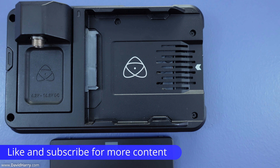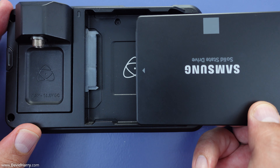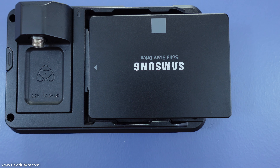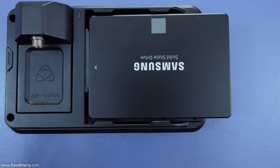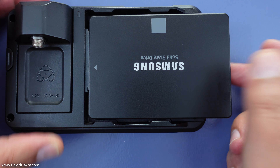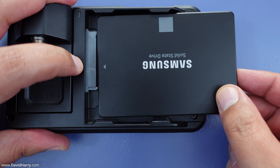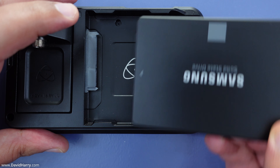Just before I show you the first use for the Lunchbox 3, let me show you something that may be familiar to some people — the fact that you can just grab your SATA SSD and directly connect it to the SATA port and power port straight onto the back of the Ninja. I have to be really honest: this is what I do sometimes when I'm being impatient. But as we can see here on the back, this drive has a lot of bend and give to it. If this drive were to take a knock from one side, it could absolutely bend forward and snap off the SATA and power interface inside your Ninja. That's why doing it this way is a really bad idea.